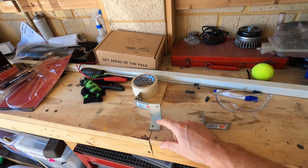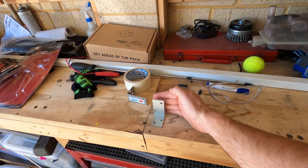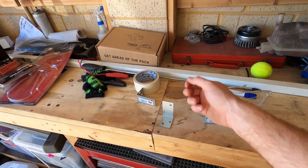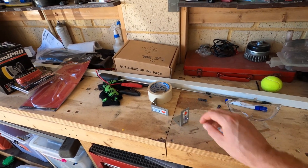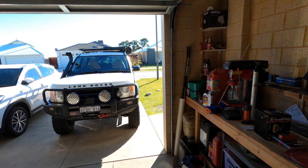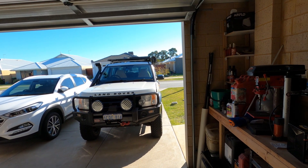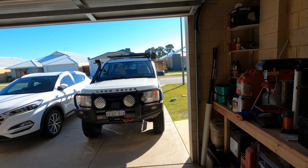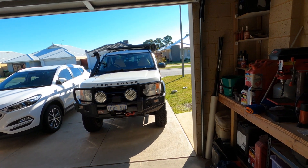I'm going to mount them so that they face inside of the solar panel and the solar panel sits on top. I'll just tech screw in from the outside so that you can't see the brackets at all — I want it to be a nice neat and clean finish. After the solar panel is mounted I'll be using sikaflex from the panel to the rack to stop any wind noise getting in that tiny little gap, because it likes to make high pitched noises.